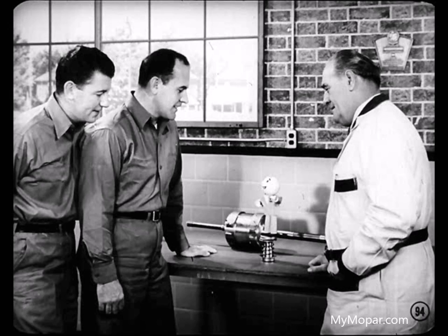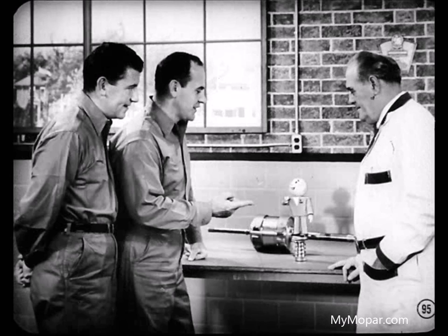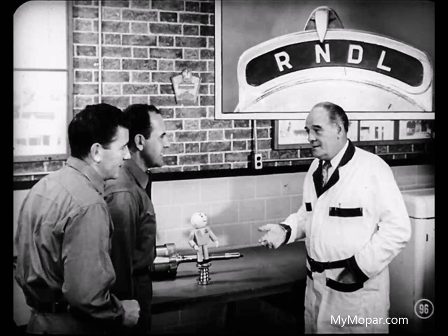Now, don't be bashful about asking questions. Don't worry, Tech. If Mike doesn't make it clear, we'll chew his ear off all right. I am kind of wondering whether anything special happens when the selector lever is in neutral. Good question, Dutch. Want to handle it, Mike? Well, okay, Tech, but nothing special happens. The gears will be turning because both bands and the clutch are released. But no power is being transmitted to the output shaft.